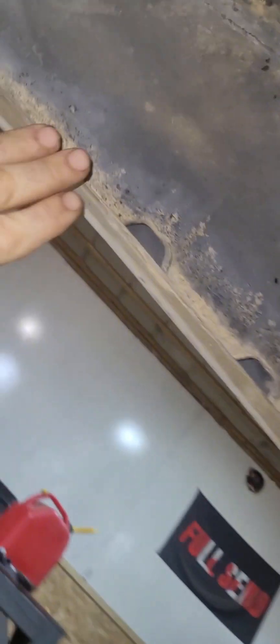Here's the underside of the box. You're going to see lots of bolts — and bolts on those rods right here — and bolts all up inside your wheel well up here, and some more bolts in there. Basically, everywhere you see a bolt in here, take them off. Except over here, this is the outside of the box and this is your wheel well — you don't need to take these off. Just basically anything you see in this inner area. So let's get started.